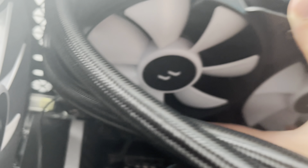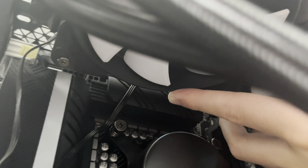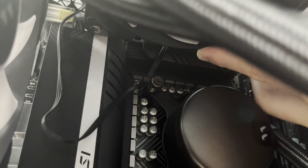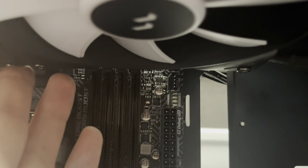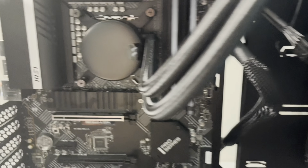As you can see, we can't actually top-mount the Fractal radiator in the case because when I push it all the way back it interferes with the motherboard heatsink. The RAM also would not be socketable. So we are going to front-mount it and put those fans up top as exhaust. I know it's not ideal, but we're going to have to do that.